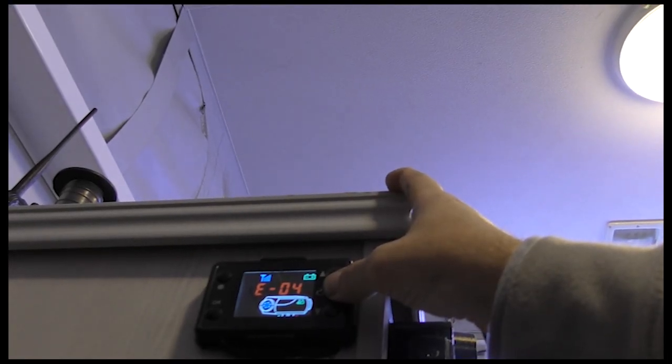I also went with the specific controller because it's got the readout — it looks nicer and gives you a lot more control. If you get an error, you can see the error messages on screen and diagnose any issues with the unit, which I did initially when I plugged it all in. I hadn't connected the pump and it went into error mode and showed me error 04, which basically said no fuel pump — so I connected it up and away we go. If you just got one of those rotary dial ones, it's going to work just as well but it won't have a temp gauge or error codes. I did mean to buy a kit with a remote control but bought the wrong kit, so I'll pick that up later. I've seen these range from about $160 — I'll put a link in the description to eBay, to the cheapest one I can find and to the seller I bought mine from.